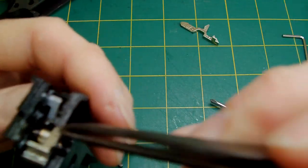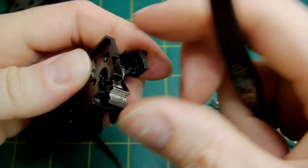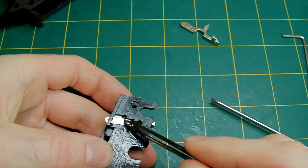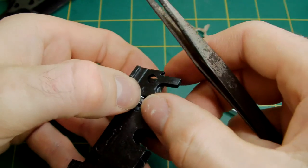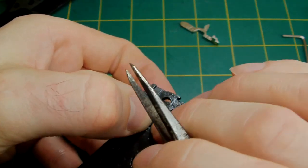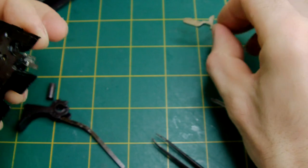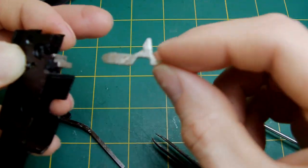This is the tricky part. If I just push the actuator forward, that then frees this up so it's able to go upwards, giving you a bit more room to put the spring in. The spring is tricky. How I do it is I put this end in first, hold that with my finger, push that in like so — I've got the spring in. Then I just push it in with my other finger and locate it into the bottom section. So you're holding it all on your thumb or finger, with the other end held in. That's locked in position. Then get your disconnector — this is how I assemble it anyway. You can slot the disconnector in afterwards, but I usually do it this way.